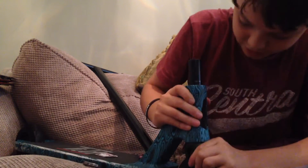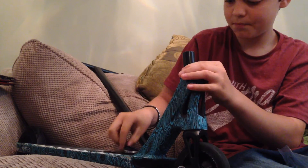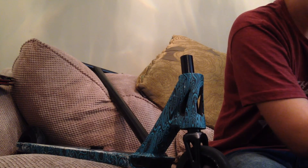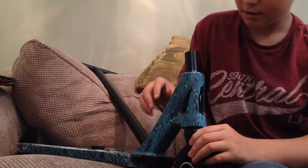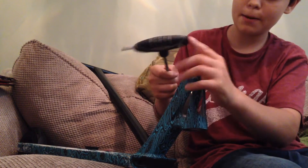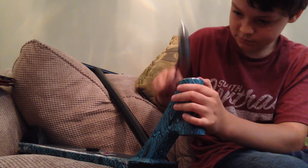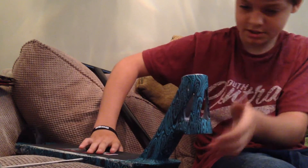You want to slide the fork up, make sure it clicks in — it will go in. Now it's in. Then get the other headset bearing and give it a little spray as well so it won't seize up. Slide the bearings in. Sometimes you want to just tap the bearings in — make sure you have a rubber or nylon tool. I've got my Anarchy nylon, so give it an even tap. There we go, that's even enough.